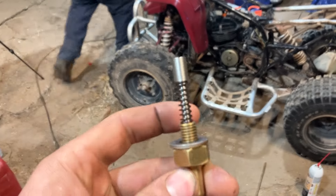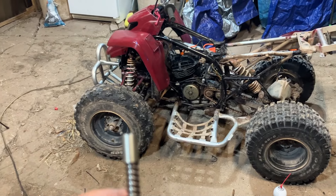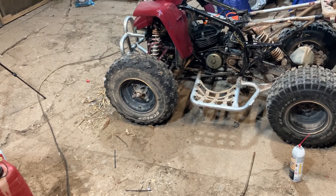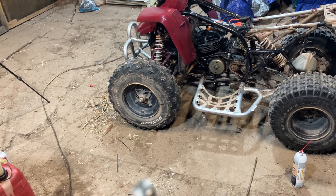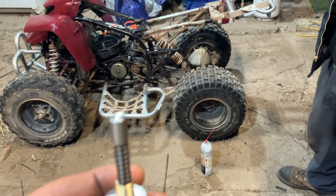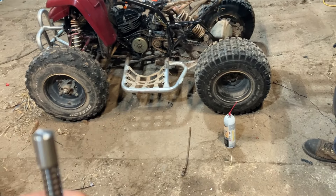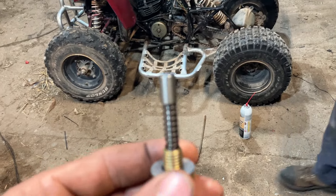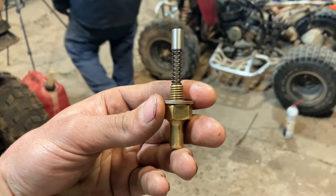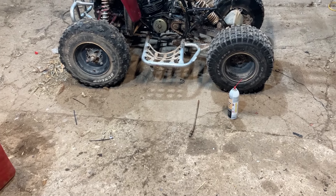So just keep that in mind. Quick little fix — I'm not guaranteeing anything, but it's cheap. You can get some JB Weld, put just a skosh on the end of an Allen key, let it sit in there. Hopefully you can either spin it or pry on it a little bit just to get it to move. We also tried soaking it with penetrating oil. Brake clean it off before you JB weld it as well — brake clean and compressed air — so you don't have JB Weld trying to seal out the oil. That's a little tech tip from us at Bear Creek Boys. Hopefully it'll help somebody out there.